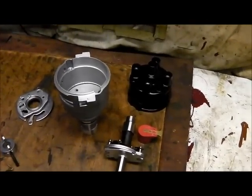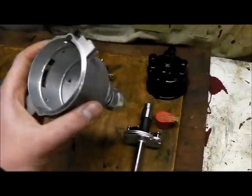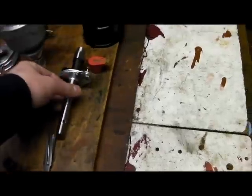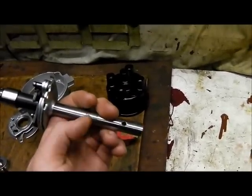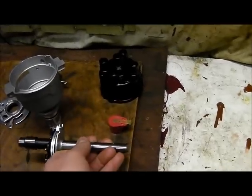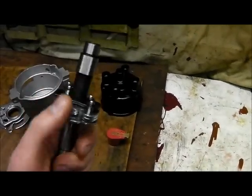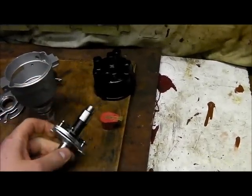Because I can't afford one of those nice rebuilt Lucas jobs, I had to buy a cheap Chinese copy from a well-known parts supplier. The main casting is okay - they've got that right, although I had to re-tap some of the threads to make it a little better. It's been bored okay, I've actually checked that all the way through and it mics up pretty true. However, it had a somewhat freshly ploughed look to it - the machine part was left slightly proud where the drive dog goes, so I've just trued it all up. There was no discernible play between the parts, and I checked the advance mechanism with the DTI and it's well within tolerance.